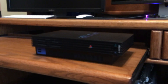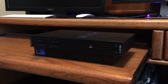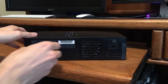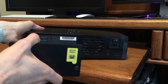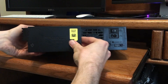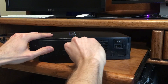Installing the PlayStation 2 hard drive is very simple. First, attach the hard drive to the network adapter and push the two pins in front to lock it into place. Remove the expansion port cover on the back of the PlayStation 2, then insert the hard drive into the back of the console. Make sure you screw down the two tabs in the back.